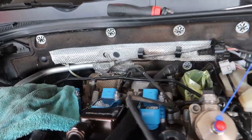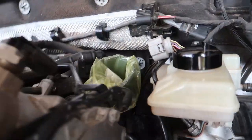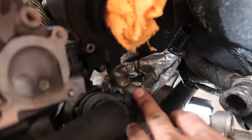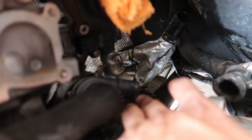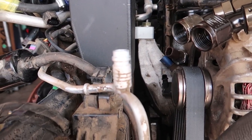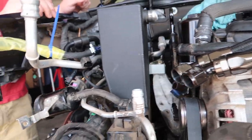The last thing I talked about was coolant lines. There's one here going off to the firewall, and down in here — that big one right there — I just disconnected it; that goes to the turbo. There was another one I undid right here: this hose goes to what I believe is the auxiliary coolant pump — the pump that runs when you turn the car off and you hear it making noise, keeping coolant circulating through the head and turbo. Downpipe is off. I'm a little concerned about it being close to the catch can, but I think we can squeeze it through without removing that engine bolt.